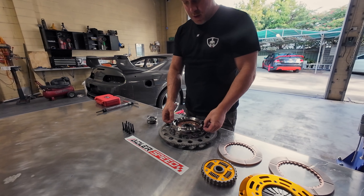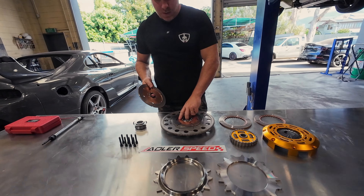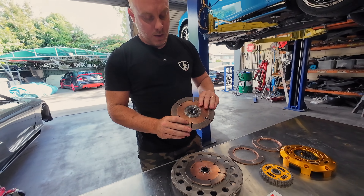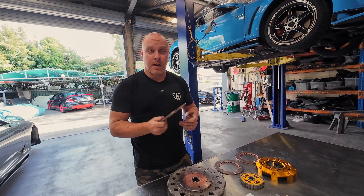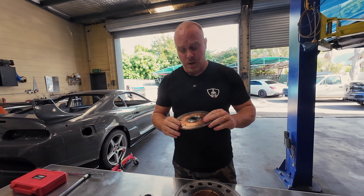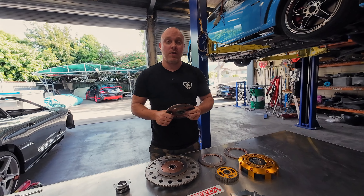Let's have a look inside — I'm pretty impressed with the overall finishing of it. Not that colour matters because none of that gets seen. Here's our first pressure plate — nice finishes on it. And here we have our first clutch plate — it's a twin plate setup. There are no springs in the hub here; these go directly onto the gearbox shaft. Because this is a ceramic disc, they're going to bite really really hard, so drivability will be horrible for street use. This is more designed for a racetrack.